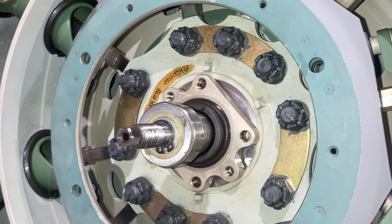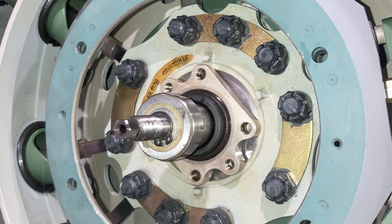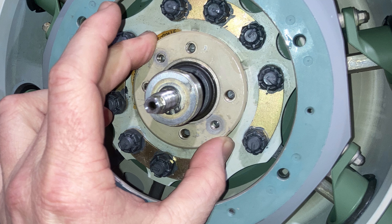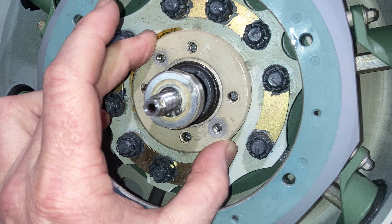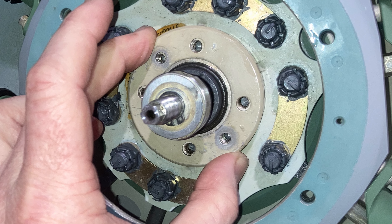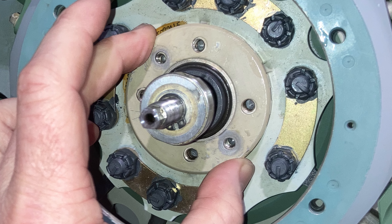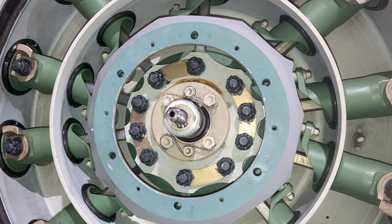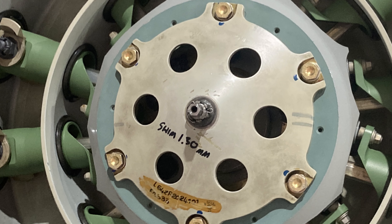After you get the tail rotor on, you put on and screw on this thrust nut by hand. If the locking washer doesn't line up with the thrust nut — because the locking washer has to line up with the tabs and the holes of the thrust nut — if it doesn't line up, you can unscrew the thrust nut just a little bit; that's what it says in the manual. After you put on the locking washer with the thrust screws and torque all those the right way and then safety wire, you're good to go.